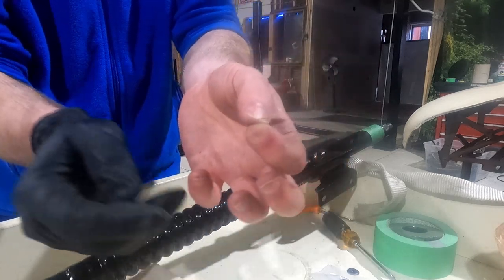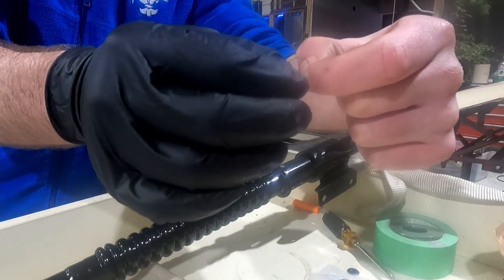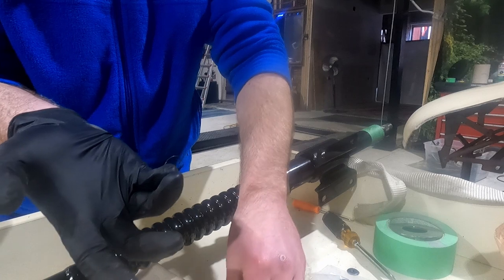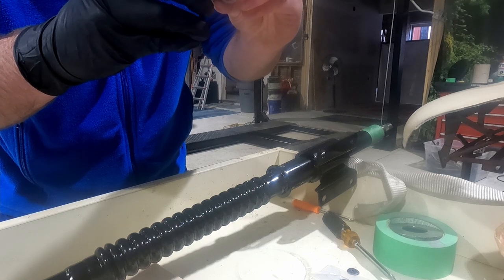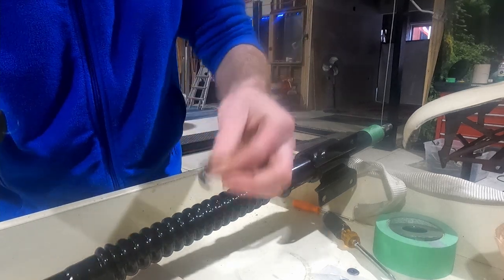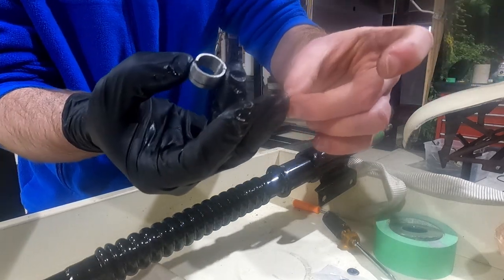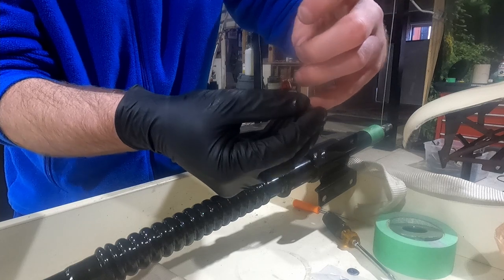I doubt this would ever wear out. If you still got one, it's almost certainly still good. It just looks like kind of a ring at this point, and then you can separate it a little bit. Get a little bit of grease on your fingers. Hold on to the ring, take your new collet, and work a little grease right into the groove there. We'll basically just be greasing the whole outside of this thing, and it should work itself into the crease. Then I'm assuming you just push this right over top, and it should fall in. You want to make sure where the cutout is does not align with where these two pieces separate, obviously, just so the spring actually functions.